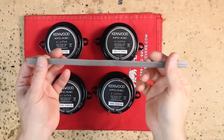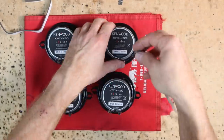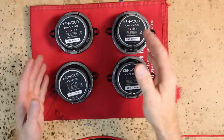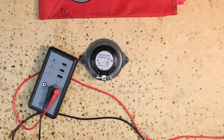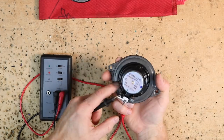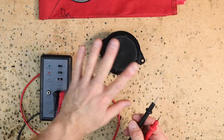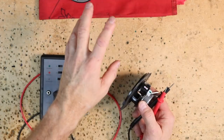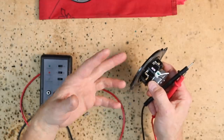The first step to get these ready to go in the car is to grab that foam from the little bag — it is two pieces of foam in one. Peel it off and go all the way around the speaker with it, then repeat on the rest of them. Now we need to find out which side of the factory speaker connector is positive and which is negative. We'll use the PT9A Plus again set to output. It's going to make a ticking noise. You can measure from the back or the front — if measuring from the front, you want it to pop green. Even though in the car they were popping red, that's the signal coming from the radio, and that's fine. This still has a positive and a negative and the radio is generating the movement.